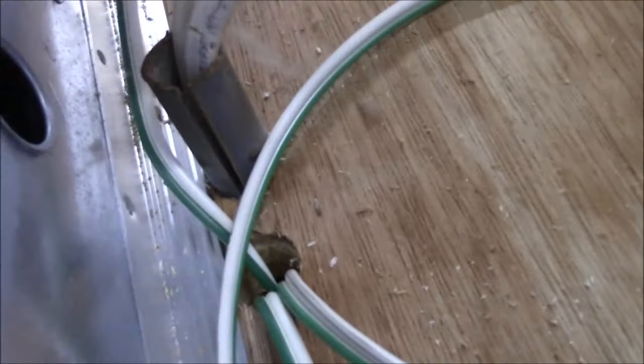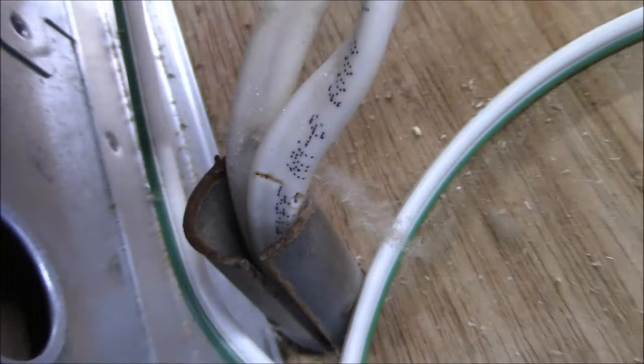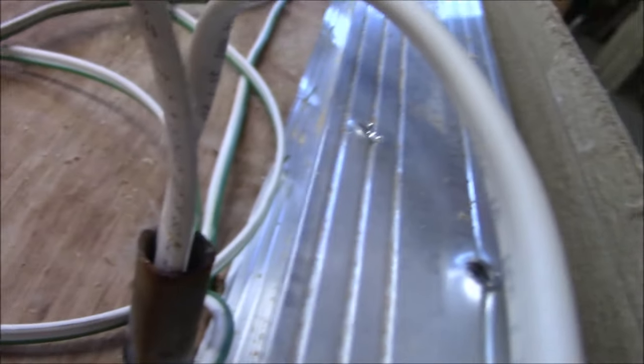Get rid of them out of here. See, it's already cutting in there. It already went right through the sheathing. I don't know what rocket scientists thought this was a good idea. One, you didn't need a ferrule up that high, but the inside of this is real sharp. Let's check out this one. There, go around the other way here. So we're gonna do a fix on it.